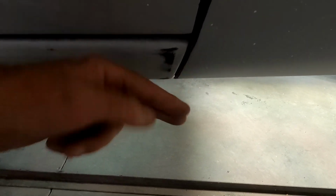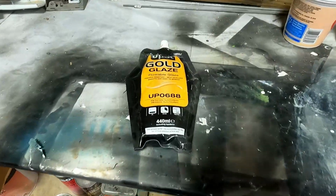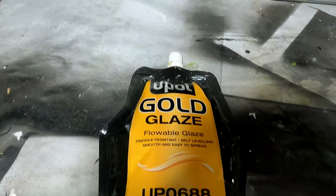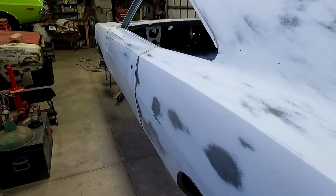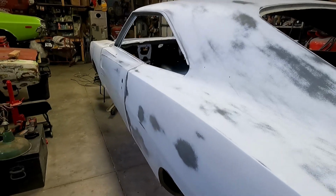This drop down is a little bit wider gap, but I can make that up. I got a little room to play, and this is Bondo here in the rocker. I built that up because it caved in when I put the new rocker on, because I'm not an excellent body man by any means. But yeah, I got a little bit of room to come back and close that up, but I'm not worried about it because I'm not going to panel match all that. Like I said, I'll just adjust the heck out of it. So we'll see. Bondo time. And by Bondo, I mean this stuff. Hopefully that's good enough. At most it's going to be 1/8 of an inch thick in that spot right there. So hopefully that'll be good enough stuff for that. We'll see. If it chips out in a year, I'll repaint the car purple.